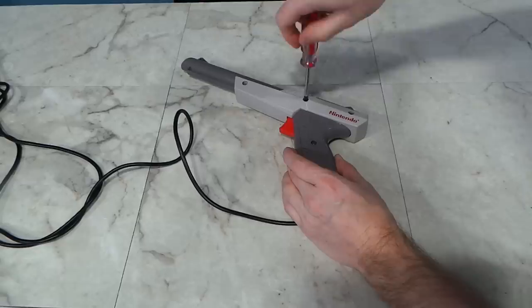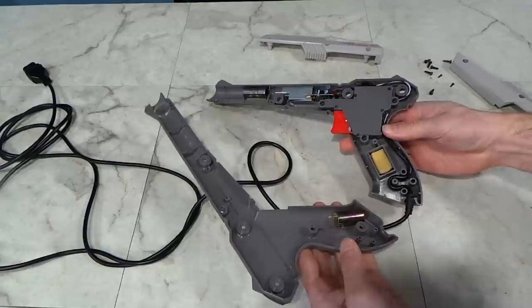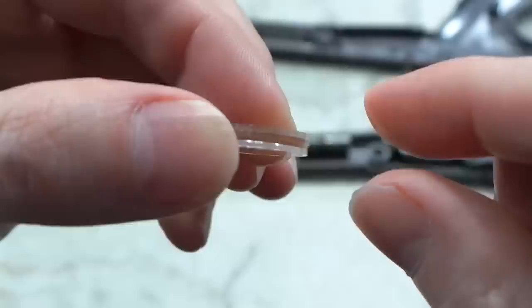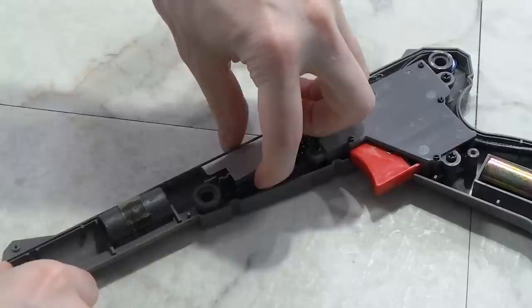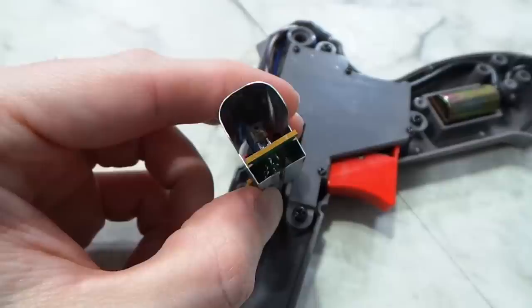Let's take the zapper gun apart and see what's inside. The assembly is pretty simple with just a few screws to remove — this part appears to be just a decorative bezel. I was mystified at first by this metal cylinder, but eventually decided its only purpose must be to add weight to the otherwise plastic toy. On the front we have a pretty basic lens — this one is scratched up but probably doesn't affect function. There's another weighted piece, oddly shaped to allow light to pass through it. And here's where all the real action happens: the photo sensor. This is not a camera — it's just a simple device that detects the presence of light, and that's about it.